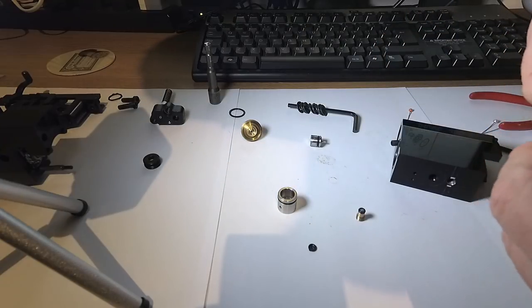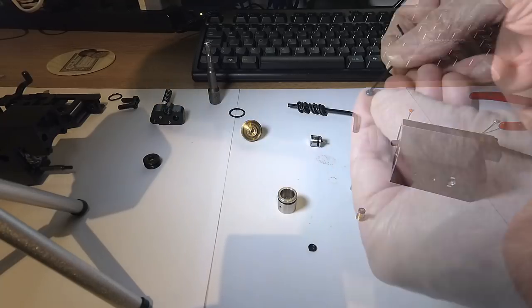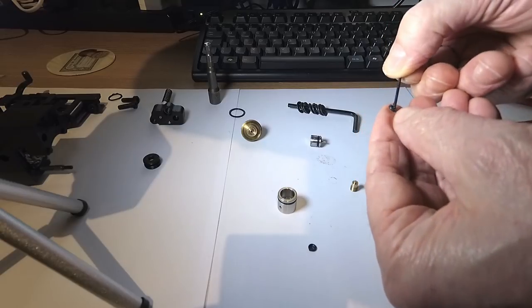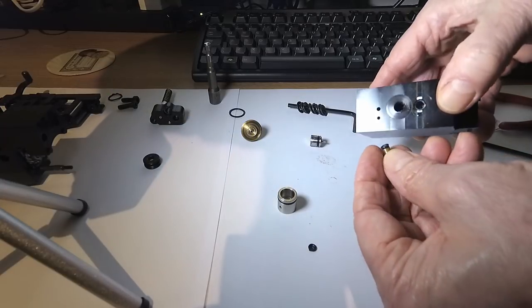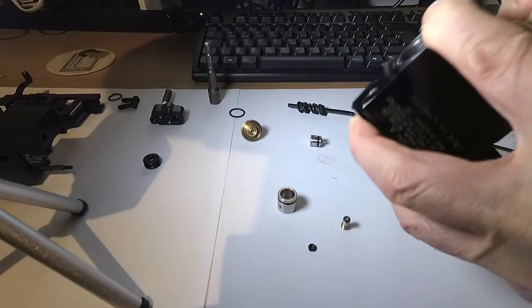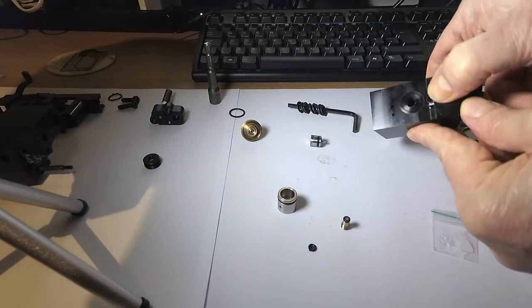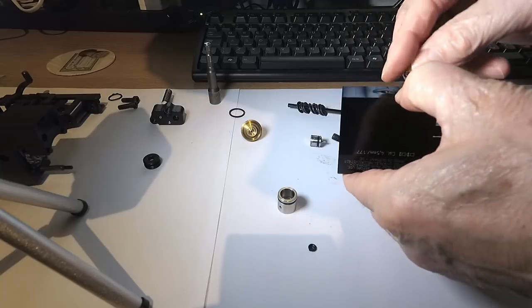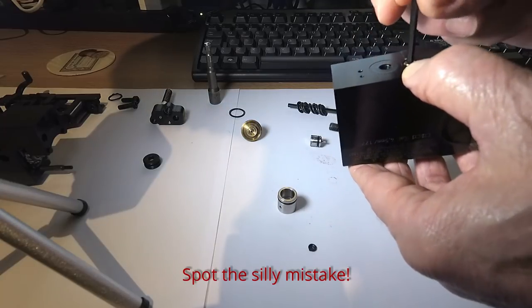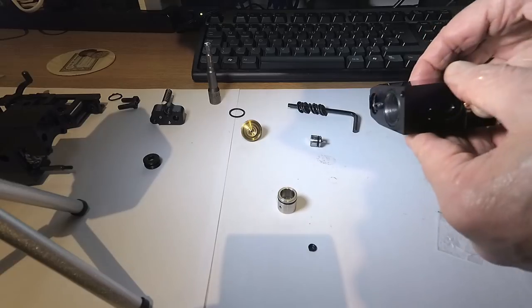Now I just need to put a spot of this moly coat onto the new O-ring and the new pressure test port seal. And now that just goes back into the port. Before I do put it in though, I'll just give it a quick clean. Okay, so that's cleaned down now inside, and I've blown through into the transfer port as well. So I can now fit this plug. I won't bother pinching that down because I'll be taking it out to put the pressure gauge on later.